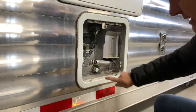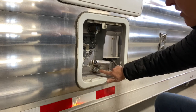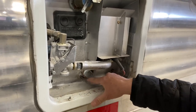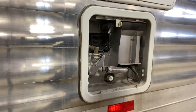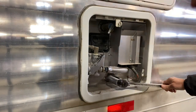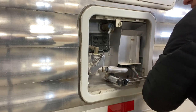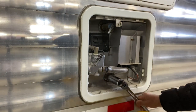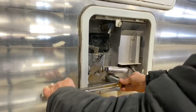So this is the anode here — the rest of this is controls and different things for the hot water heater. Let me get in here closer and show you that underneath there. It has plumber's tape around it to make sure that it doesn't leak, but that is what we're going to take out. So I'm going to put my socket on there, and we're going to remember righty-tighty lefty-loosey. Let's see if we can get this baby to come out of there. It'll take a few turns — hold that bucket up there just with my knees.